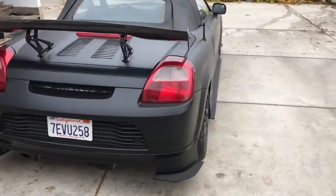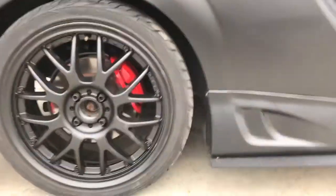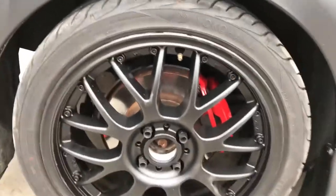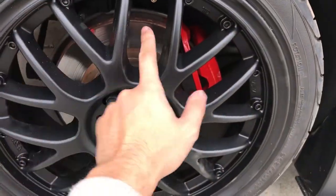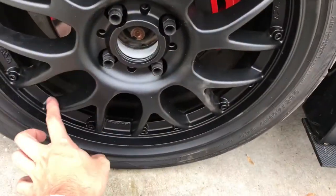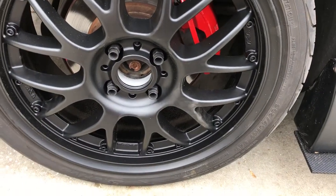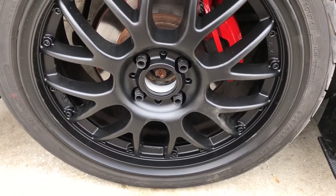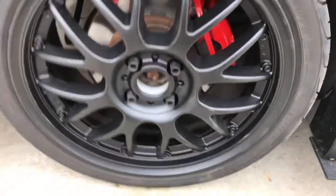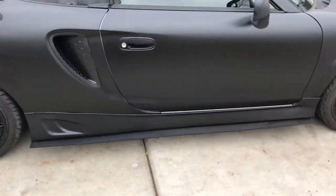Alright, so it's all done. Here's what we got — this side is all black. The plasti dip went on really well. Apparently, if you spray one whole giant coat with a spray can, coat it all wet, and lay it on its side or flat, it will look all smooth and wet when you apply it. If you let it dry without putting any more coats on it, it comes out really smooth. I didn't know that — I put a second coat on there so it's a little bumpy, but that's good to know for next time.